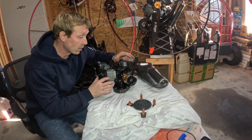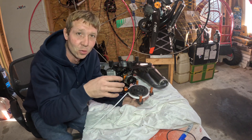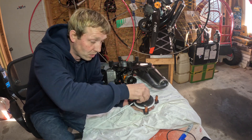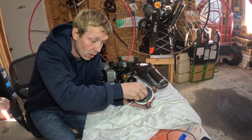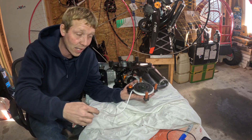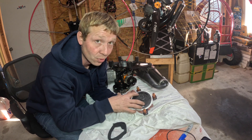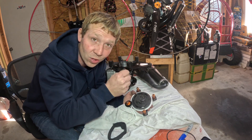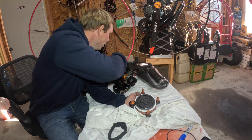I had to look at a couple things on YouTube because it was a little tricky at first, but I'm glad I did, because it showed how important it is to actually spool the spring all the way back. It's one thing to pull back the whole wheel, but the inner piece where the spring is — you have to get it to rotate fully. I actually had a time on the field where this broke and I fixed it on the spot, but I didn't spool the spring all the way back, and I always had a lot of slack in my pull cord since that first original break.